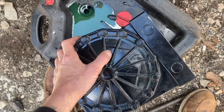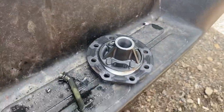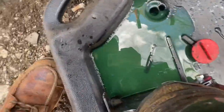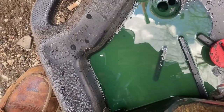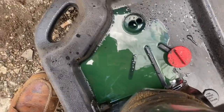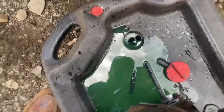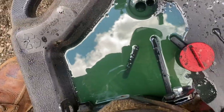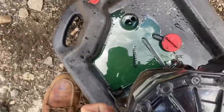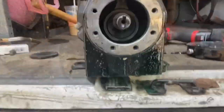I got the back off — the impeller and everything for your oil and all that. I just wanted to show you this while I'm draining some of the oil into my pan. See how that oil is green? It's got a greenish tint to it. That's obviously because this compressor has had moisture in it — POE oil, if it gets a bunch of moisture, at times it can turn that greenish color. Just thought I'd bring that up if you guys have never seen that before.